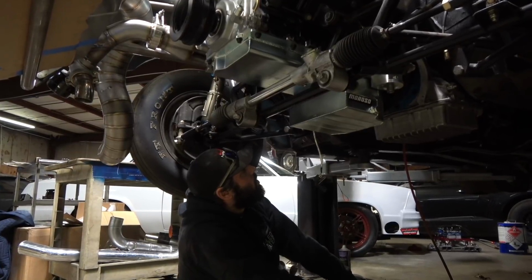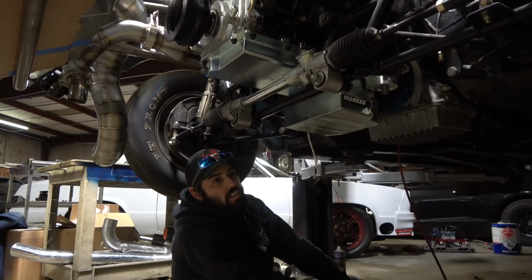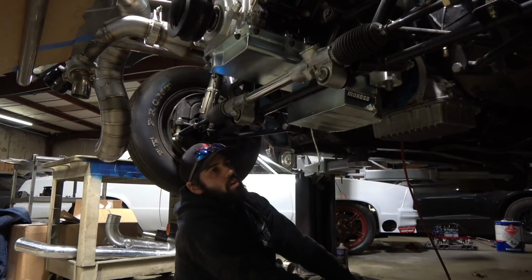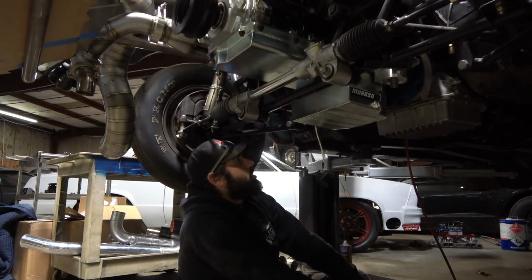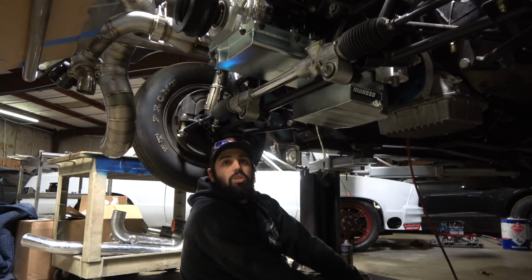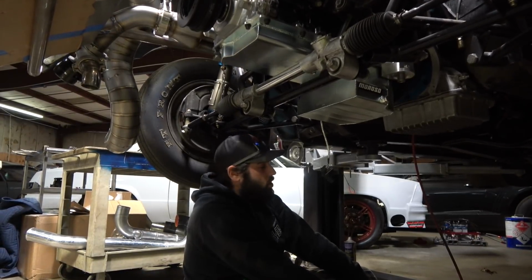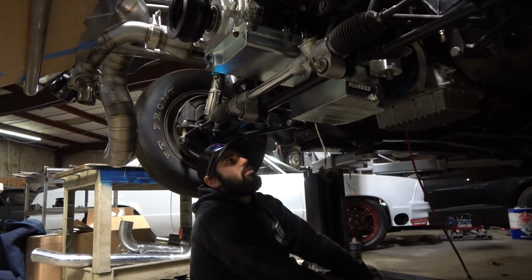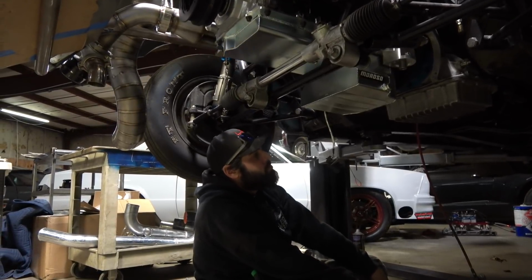I'm going to extend the oil pressure connector and the cam sensor connector, and then everything else will plug right in. It's pretty good. Running the coils on the valve covers, everything plugs right in. Don't need to run any extension or anything like that. So we're definitely getting close. Once you get all that plugged up, mount the Holley, run the power. We've got to do dome pressure, boost control, shifter, and then that's it. I think I'm gonna run an air launcher and parachute, but that won't have anything to do with the Holley. No transmission harness or anything like that. Oh, wire up trans brake. That's the other thing. The factory LS harness for an LS makes it super convenient to just slap on there. Highly recommend.